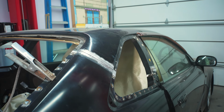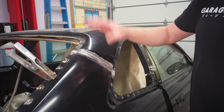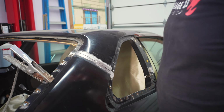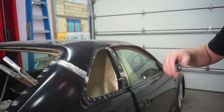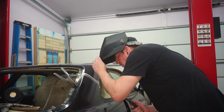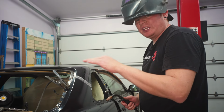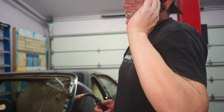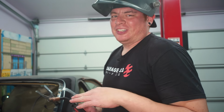It's feeling kind of spattery, so I think probably we put our greasy mitts all over it while handling it, and that's interfering. So anytime that happens, just clean it again and it should help. Yeah, now it's nice and crisp and immediate. That's a nice clean weld. If it sounds like Friday night after Taco Bell, it's probably dirty, clean it.